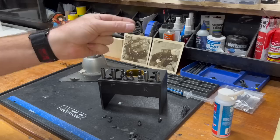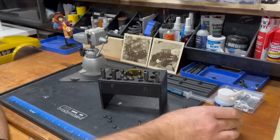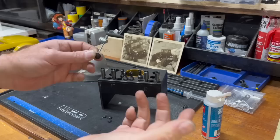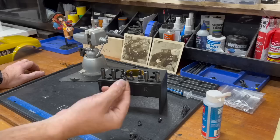I've got all four pretty darn close. You generally want to be about a millimeter down from the top — you don't want the meniscus doming over the edge. Because the bladder points down, when you push the bladder down you don't want to see a ton of oil — should just be a little wet on the front. We're trying to trap minimal air, but even in a perfectly built sealed shock you'd have to build it under oil to not get any air in at all.